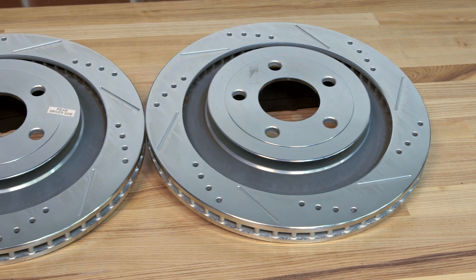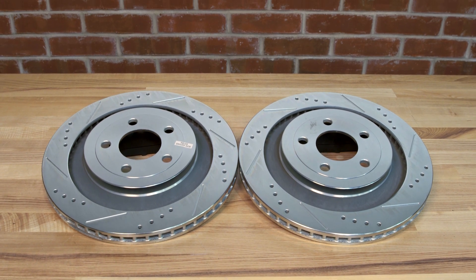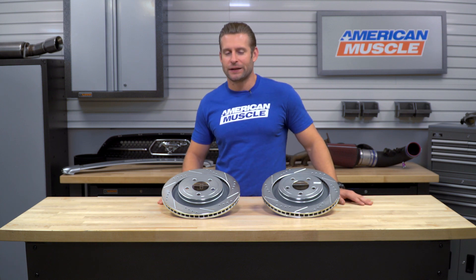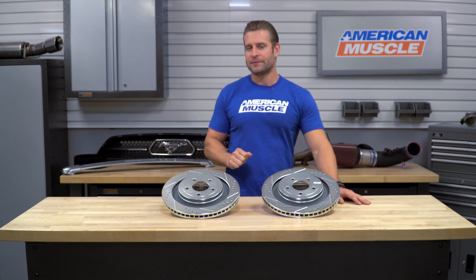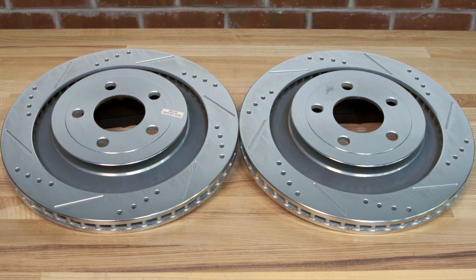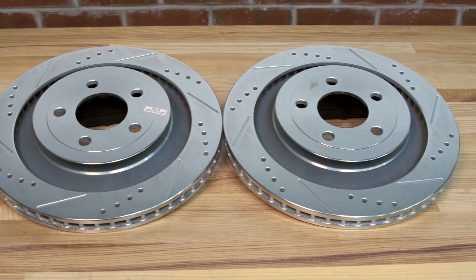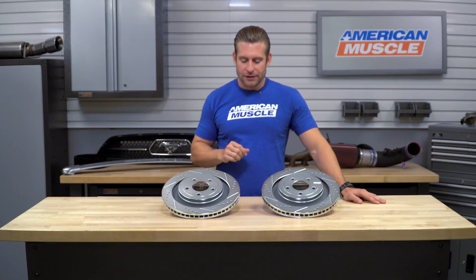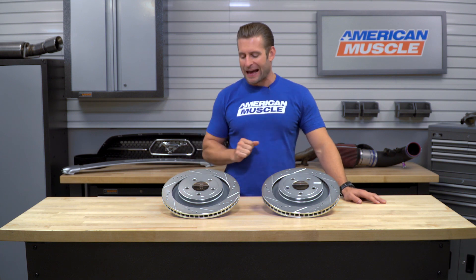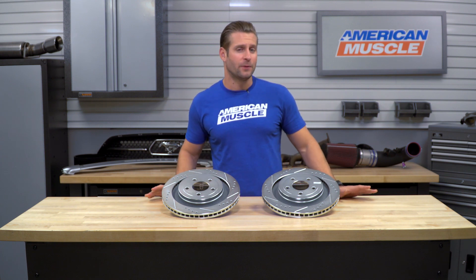With the rear wheels removed, you will need to go ahead and remove the rear calipers as well before you can actually remove the rear rotors. In order to do so, you will just need a basic socket set so you can tackle the two bolts securing the calipers to the rear of the car. If you did grab some new pads, now would be the time to swap those out. With the caliper out of the way, you can now go ahead and remove the factory rotor. Sometimes a rubber mallet or dead blow hammer can be helpful here. Also watch out — sometimes Ford will throw on a little clip securing the rotor to the actual hub, so make sure you don't have any of those in place. If you do, needle nose pliers or something similar will help you get that out of the way.